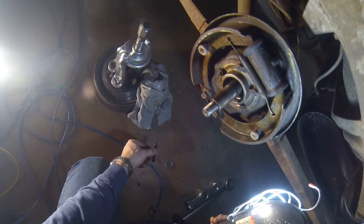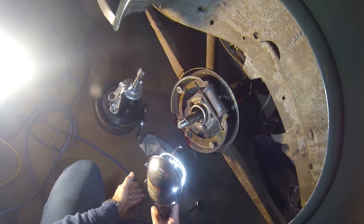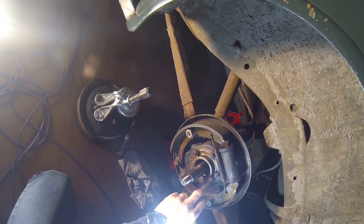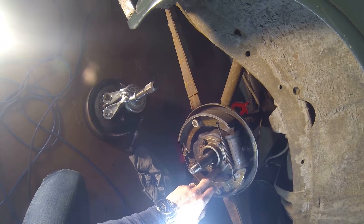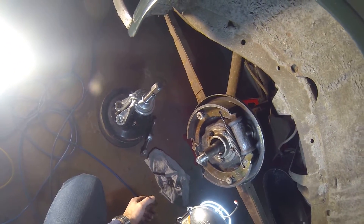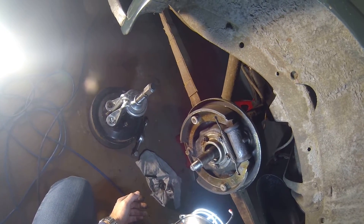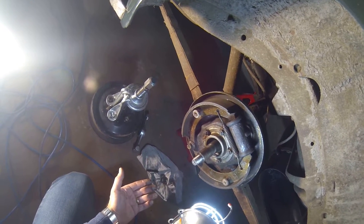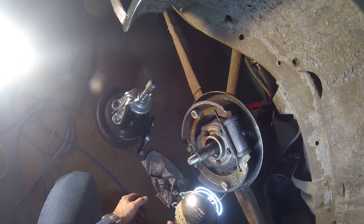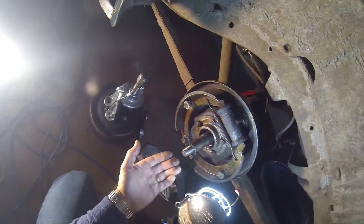There's the keyway in the axle, cotter pin, nuts, and the tool. What I'm gonna do next is take all this apart and put in new axle seals. There's an outer axle seal here and one on the inside on the bearing as well. I'm gonna slide the axles out - in one of my other videos I talked about doing this job on my 53 Chrysler and took some videos. So just look for that video; I don't think I'm gonna make another one for the 38 Plymouth. It's the same procedure, just a slightly different design of the seals.